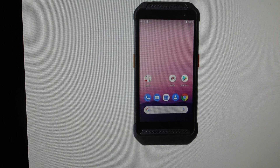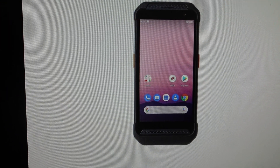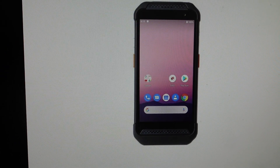What we need to do is have the device turned off. Then we're going to press the power button and the volume up button together, with the device off, and hold those two buttons until we feel the device vibrate. Once it vibrates, we can let go, and that will open it into recovery mode.